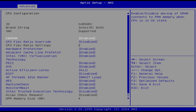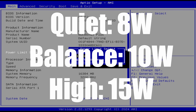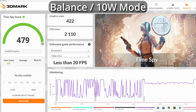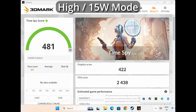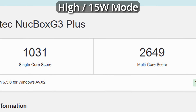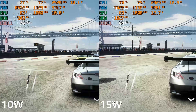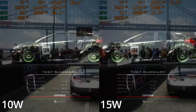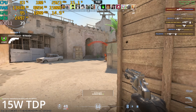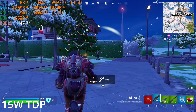The BIOS in the G3 Plus has many options you can play with. The standard settings such as Secure Boot for Valorant and Riot games will need to be turned on here to play them. We can also adjust the TDP in order to either quieten or speed up the system. We raised TDP to 15 watts, and that improved our CPU score in TimeSpy substantially, though it didn't do anything for our GPU score, and in Geekbench it oddly went the other way. In games, we did see an improvement — Grid Autosport gave us around 10 more fps. Counter-Strike 2 has similar performance but uses most of the 15 watts. In Fortnite we experienced slightly raised fps, but still with a similar slowdown.